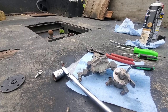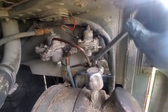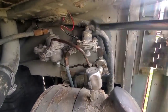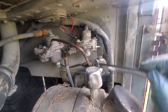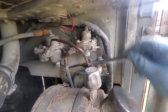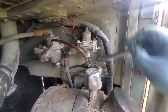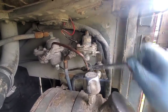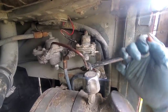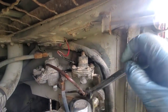It's ready to go back on the bus. Now that we've got the valve back in here, we've got all the lines started. There's just two bolts right in here and here against the body to hold this one up in the chassis. And then this line, this line, this line, and the one on the bottom right here. There's one extra line on this one but it's not a big deal. There's actually better access on this one — with a normal length gear wrench, when you do the other one you're hitting the up pipes and all that stuff. This one you actually have room to get in here.